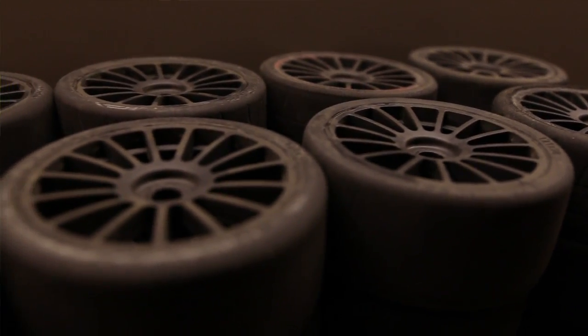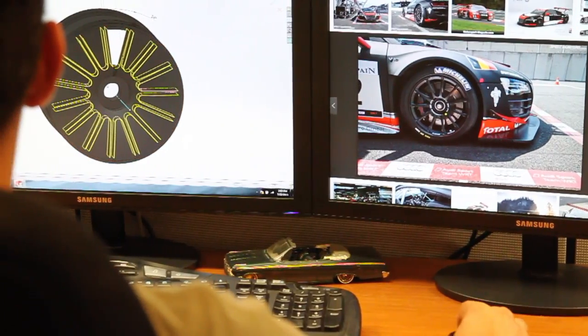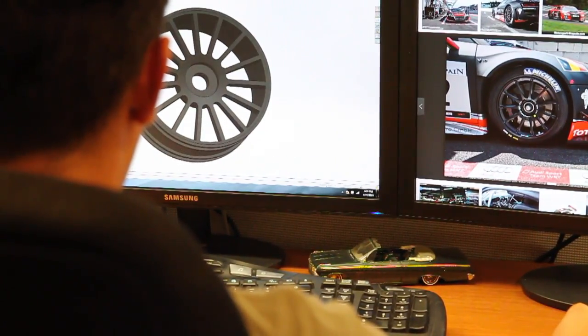Any racer of any sport will tell you that tires are a majority of where the performance and handling of a vehicle come from. So developing the Circuit F6 tire was a high priority. See, most rubber tires actually balloon as the RPM increases. This is something that severely affects the performance and handling negatively. So we solved the problem by molding belts into the tires to prevent them from expanding. Then we moved to tire compounds. We tested different compounds and surfaces to make sure we found the balance between performance and wear. We wrapped the tires over the race wheel with injection molded metal wheel heads to make sure the wheel wouldn't strip.